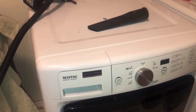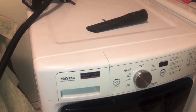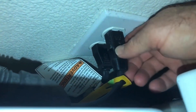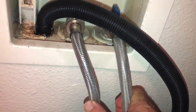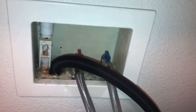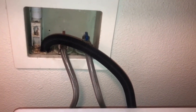So let's go step by step and figure out how to get to this filter. This is going to be a little trickier — this is going to be full of water. You're going to have to shuffle it out away from a wall, and it might take two people. First things first, I'm going to unplug the unit. I have my washer and dryer both here and they're kind of tight. That way I make absolutely sure I get it unplugged. I should be able to perform this keeping the cold and hot water supply intact, though you may end up having to remove those. Make sure when you get started, have a couple buckets, a shallow bowl, and a bunch of rags and towels.